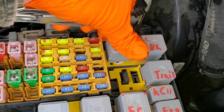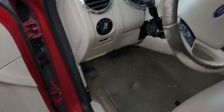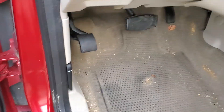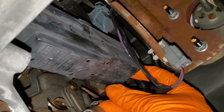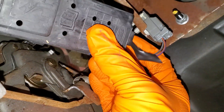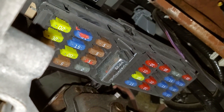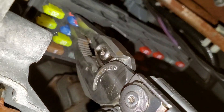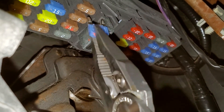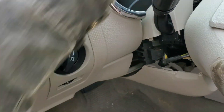So we're going to head back inside the car. The fuse that sends power to the ignition switch is going to be down here. This fuse box, which you remove by pushing on this little tab, has a 15-amp fuse that carries power to the ignition switch — this one right here. You can pull that out and look through it to see if it's blown. As you can see, that one's in good shape.